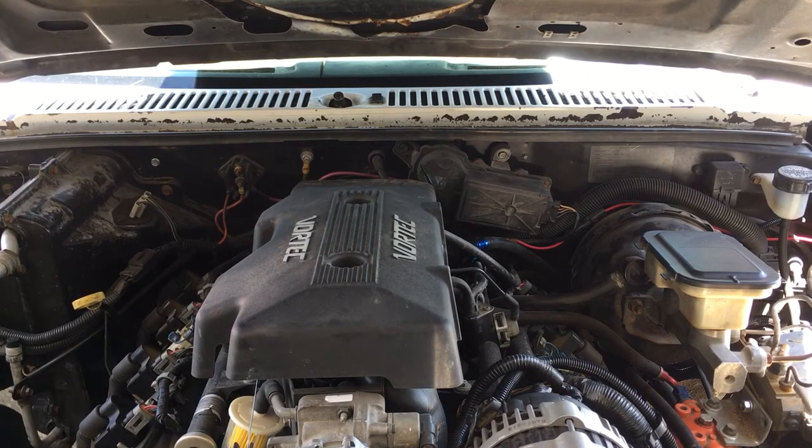All I can do is clean the ground, because I've got additional ground from the motor mounting bolt to the firewall. Maybe I need to add another ground cable from the engine to the firewall. They were working when I first got the swap running, and then they were having that weird thing where every time you energize the ignition switch they would cycle one time. Every time you'd power up your ignition cylinder they would cycle one time. And then I saw it where I hit a bump hard enough, it'd make the windshield wipers come on and then go back off just one cycle. And then out of the blue, boom, they just stopped working altogether. Maybe that is a sign of a bad ground, or an intermittent ground, or something of that nature.